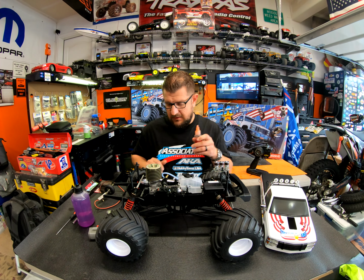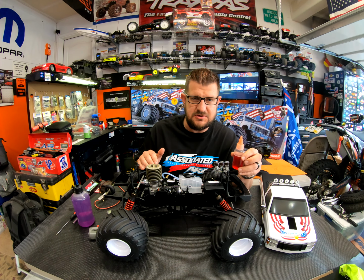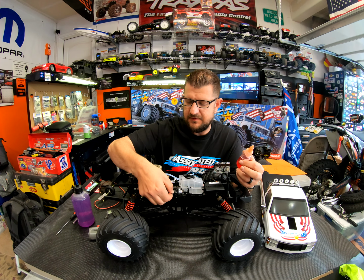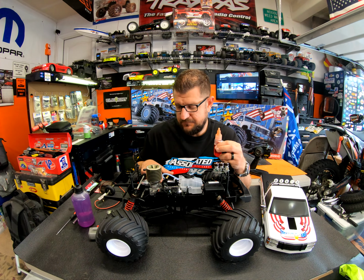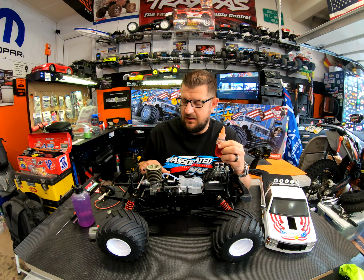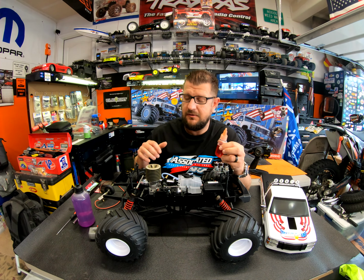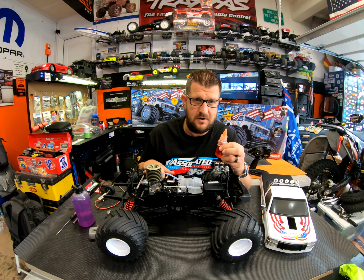And that's going to prevent any premature engine wear the first time you pull that cord. And when you drop it in the carburetor, you may have to open the slide just so it actually goes down in the engine. So that oil is going to run down into the crankcase. It's going to mix in with your front and rear bearings. And also the first time you pull the cord, it's going to get mixed in up in the cylinder also. So right away, we've got lubrication in this engine before there ever even gets fuel to the carburetor.